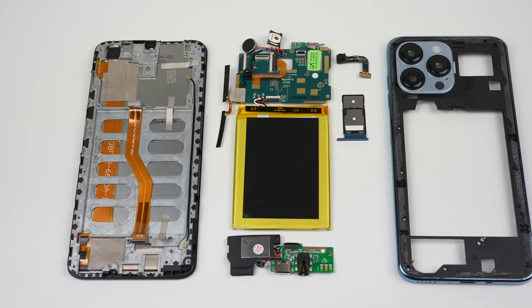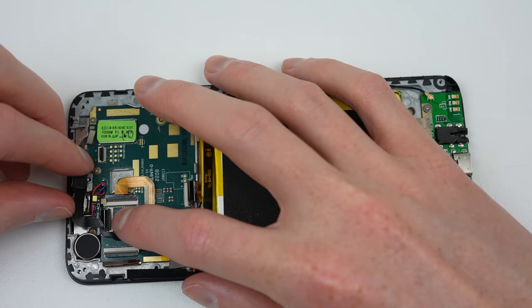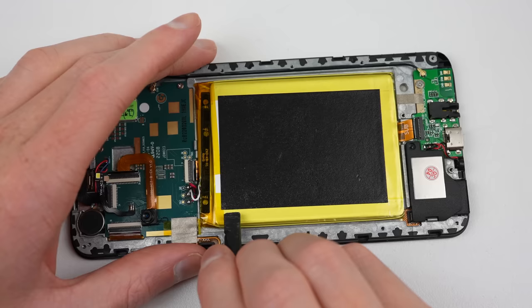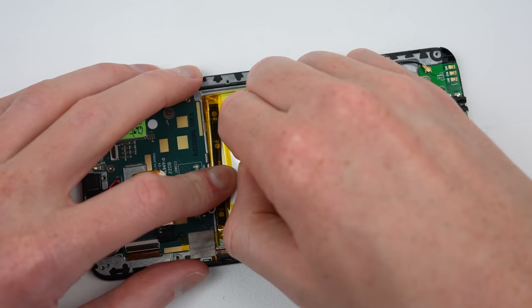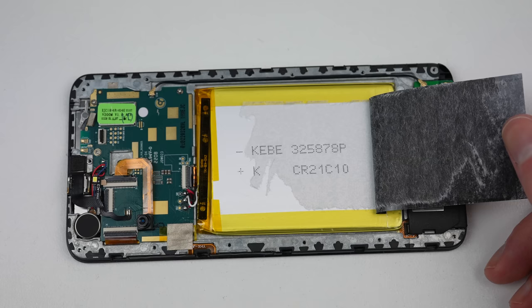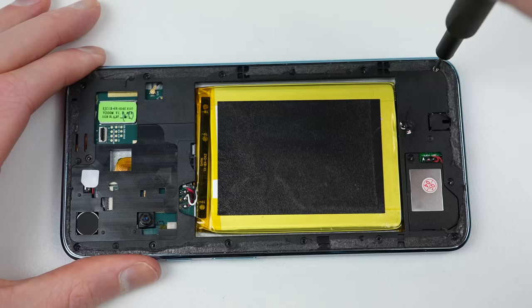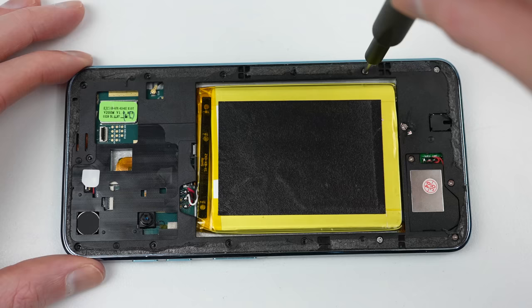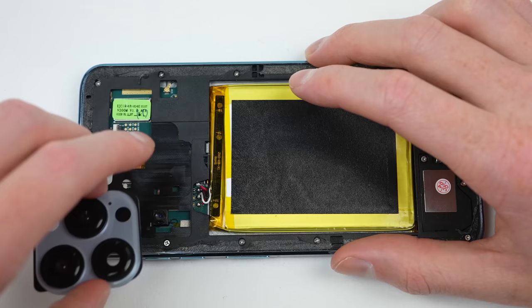Overall, this phone is not very modular and really only consists of 4 major parts. During reassembly, before getting the midframe and back panel reattached, I want to take a closer look at the battery. If like everything else, it won't be the advertised capacity of 6800mAh — I've worked on enough phones to know a 6800mAh battery would be a lot bigger than this. There is a model number under the sticker, however I wasn't able to find any results or a datasheet on the battery itself, so its true capacity is unknown. I can now reattach the midframe, its several Phillips head screws, the SIM tray, the two fake cameras, and the glass back panel.